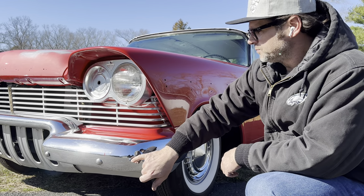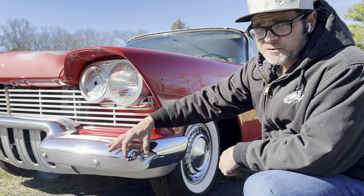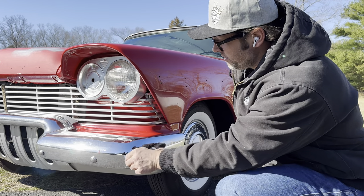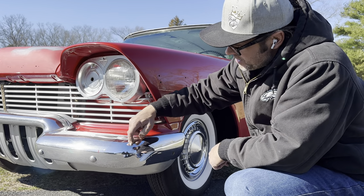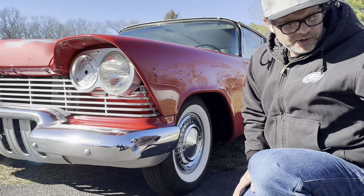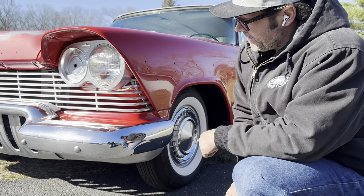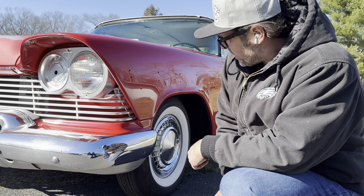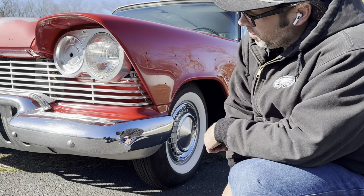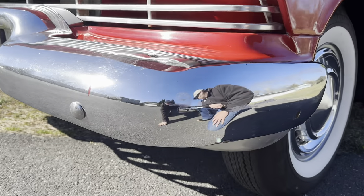To make it even more accurate, run a piece of masking tape below, above, and on both sides of the putty mark, then draw your crosshairs for the centers of the square. When you remove the wing you can connect the lines and have your crosshair dead center of where your bolt needs to be drilled. We're dealing with a half-inch carriage bolt here, so I like to drill a 5/8-inch hole to give you that additional level of adjustment when fitting the wing on your bumper.